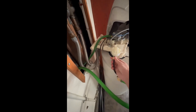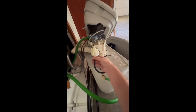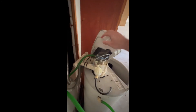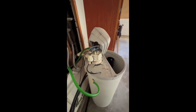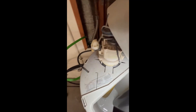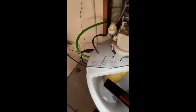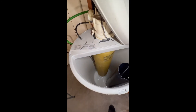So it's nice and firm. Then I'm going to reattach this hose, just like so. And then I'm going to pop this head back down — as you can see, there are a couple of clips right here and it just clips right back down pretty easy. Then I'm going to fill this guy back up, make sure I have everything hooked up, fill it back up with a little bit of water and a little bit of salt and confirm that it works. Then fill it all the way back up with salt and I'll check back in with the results.